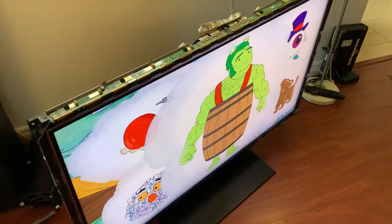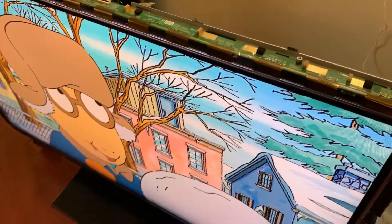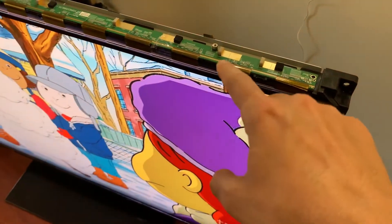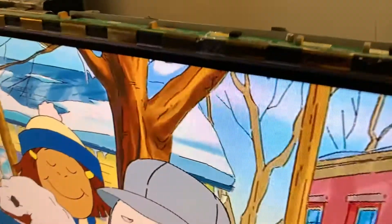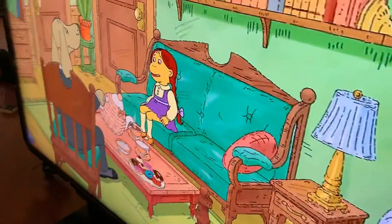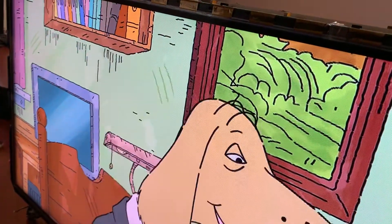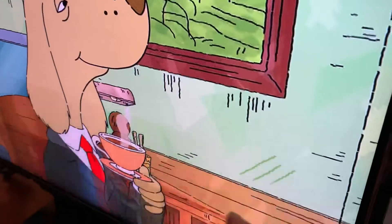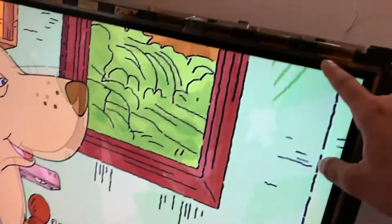So through this simple diagnosis, we find that there are little chips on each of these ribbons and those chips get really hot — it's actually impossible to touch them. Like that is one of the chips, this is one of the chips. I believe that over time, as it keeps heating up, the flex ribbons slowly lose their integrity. So for this particular display, as we can see, these blackened lines that keep coming are linked to this one.